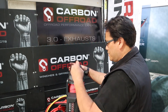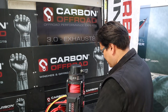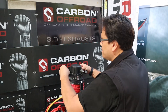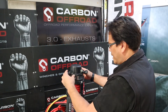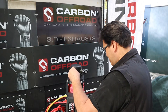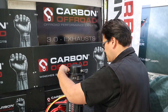We'll just make sure that gasket is seated in there correctly. Now we'll just pop all these back in. The best way of doing these up is in a criss-cross pattern, just so it equalises the pressure on the gasket. Now there is a torque setting for this — it's about two and a half newton metres of torque, so I'll be torquing these up with a torque wrench once we've put all these back in.